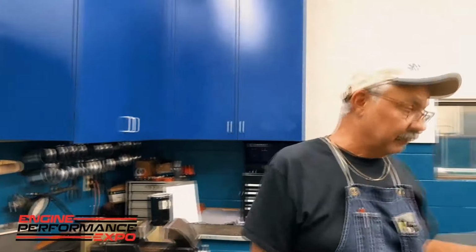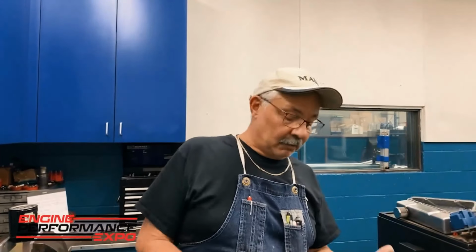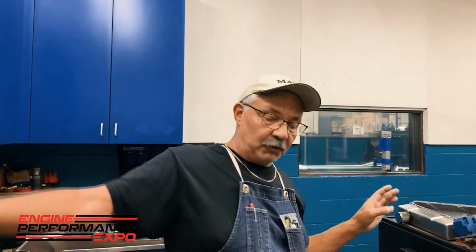And sometimes when we're working on a sprint car engine that's making 950 horsepower, if we screw up, we put 1 degree too much timing, not enough fuel, whatever, we will start to develop a problem with the piston. The piston will actually start to melt. And literally when that piston starts to melt, it only takes 4 or 5 seconds for it to be totally gone and destroy the motor. So if we have any issue at all, or we want to make sure that after our dyno pulls on one of those 950 horsepower motors that everything's okay, I'll take that borescope and shove it down the spark plug hole and I'll be able to see the majority of the piston and make sure that everything's okay there. That's a very, very important tool.